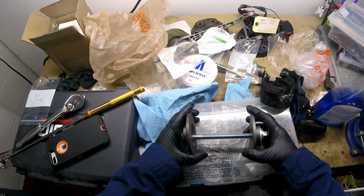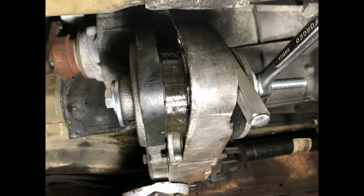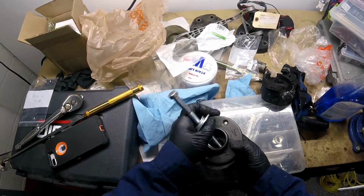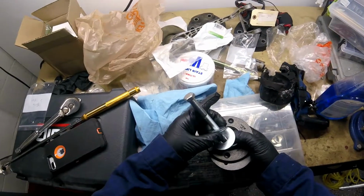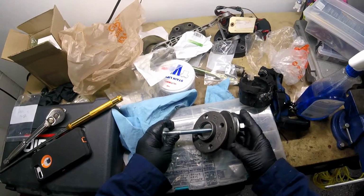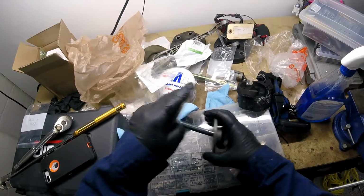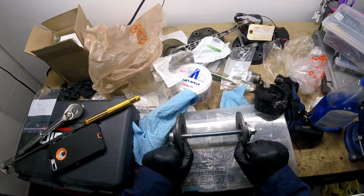So what I did was compress that bushing in. I have a picture of it as well. I got these from Home Depot. It's an inch and a quarter floor flange, the pipe mounts into. Then I got half inch washers. I got a larger washer, I think a 3/4 inch washer. And this bolt here is a half inch by, I believe, 8 inches. I did the same thing on the other side, put a larger washer, two half inch washers, and the nut. I used both ends to screw in using the nuts, compressing the bushing in there.